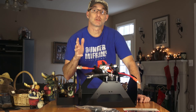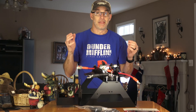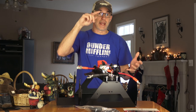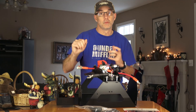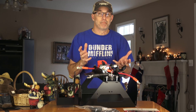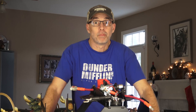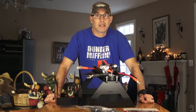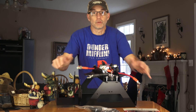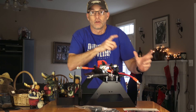I started thinking: how do I limit the load I'm putting on my main vehicle battery by draining it constantly and then recharging it? So I started looking at battery packs specifically for my dash camera. They're basically lithium ion batteries that you plug in - it's hardwired. The batteries charge up when the vehicle's running, and when the vehicle's turned off the camera works off that battery exclusively and doesn't pull from your main battery. But what am I doing? I'm adding a second battery into my system anyway - and worse, I'm adding a battery that's prone to not liking heat and cold. Even worse, those battery packs are like $300 anyway.